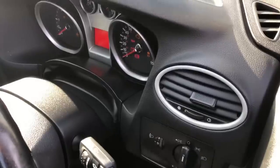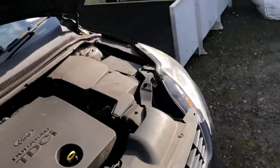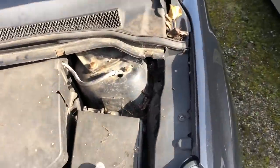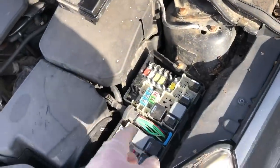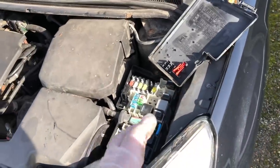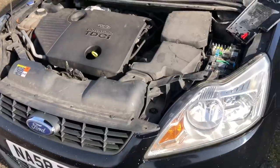I've just jumped in it this morning, tried starting it, glow plug light out. And it is coming up now - engine malfunction and the battery is running low. So I'm going to get involved. First of all I'm going to go through every single fuse on the car in the fuse box here. There is another fuse box inside the car, so I will pop it on time lapse and go through all of them. I'll go and grab the jump pack and then start investigating what is wrong with this car.